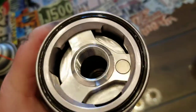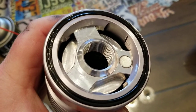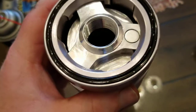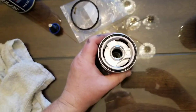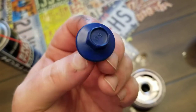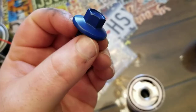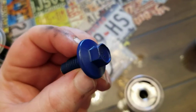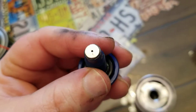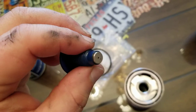You can see right there's the old O-ring. When you replace the O-ring, try not to use a screwdriver because you don't want to gouge the aluminum — just take a pick, like a dental pick or an automotive pick, reach in there, hook the O-ring out and it pulls right out. This here is the dimple drain plug — it's anodized blue and it's got that rare-earth magnet on the end. You can definitely tell it was filthy a while ago; you couldn't even tell there was a shiny magnet on the end of it.